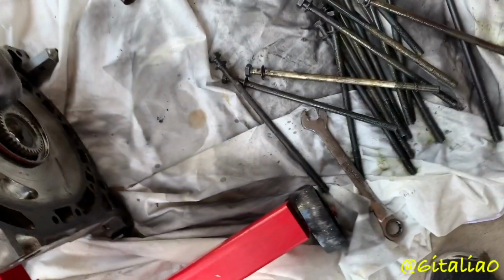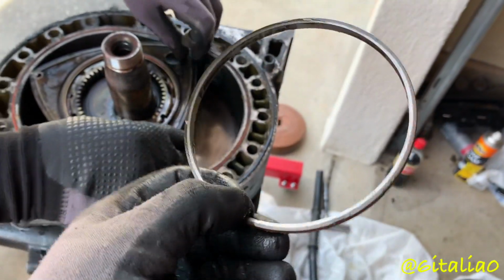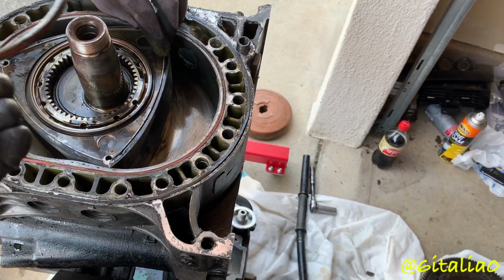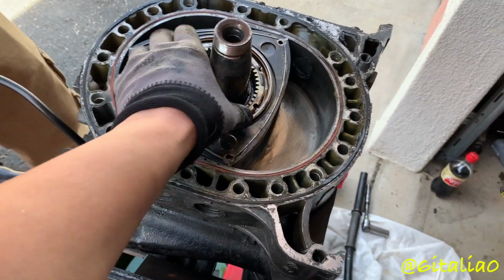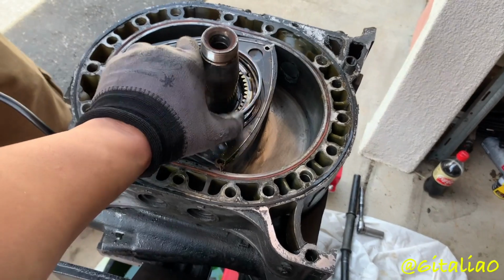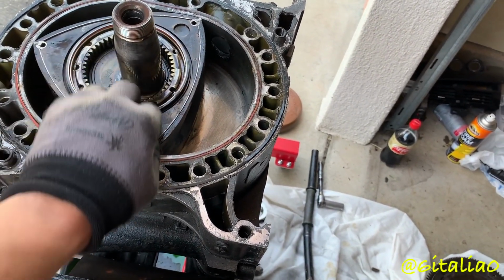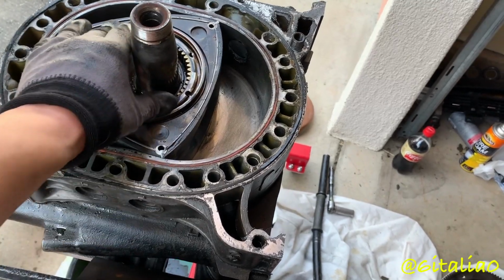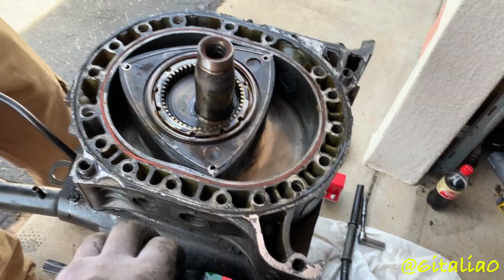Oh, okay. I got really confused for a second. I thought that he didn't put another oil control ring in. So it was missing one, but these are not seated correctly. Like, these should not just come out like that. That's why it was burning, although they look okay. Yeah, they don't look bad.